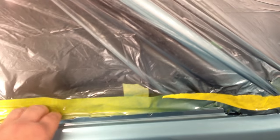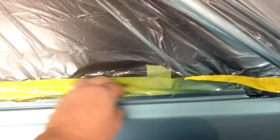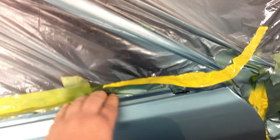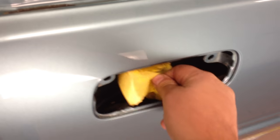To get that super mirror look, like a show car, you will need to buff and polish. But think about this — this is a repair job, and the goal is to make it an invisible repair, where it's not noticeable. So if we get this door, hood, and fender and we sand them out and polish them to mirror, show quality, that's not gonna match the rest of the car, because from the factory there is some orange peel. We really don't want it to look a lot slicker than the rest of the car, because that would be noticeable.